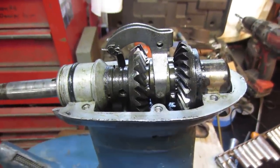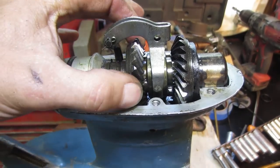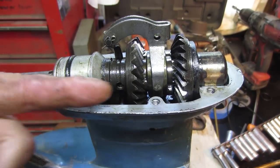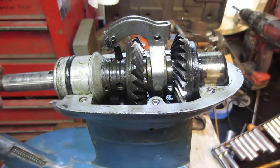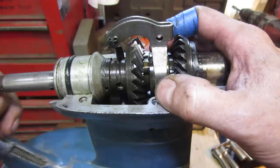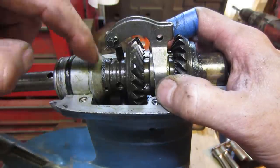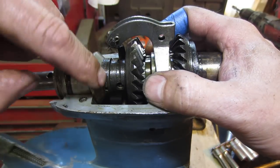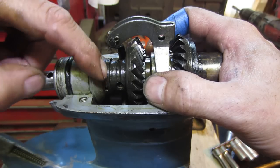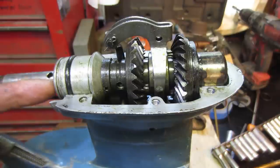Yeah, so it's kind of screwing up a little bit. I put it together, and I had this facing the other direction. I'm like, this gear is slopping back and forth. They're supposed to both be in contact with the gear down below at all times, and the shaft's supposed to spin free. And all of a sudden, I said, oh, yeah, that's why, because that guy's upside down. It has a brass bronze thrust face right there that, as the pressure goes against it, has something to push against. And of course this side was just the seal.